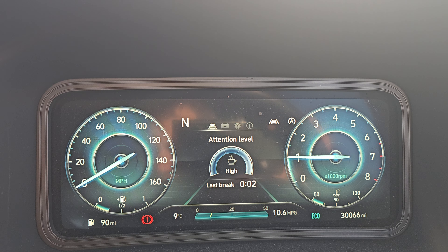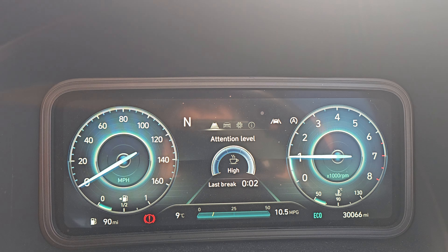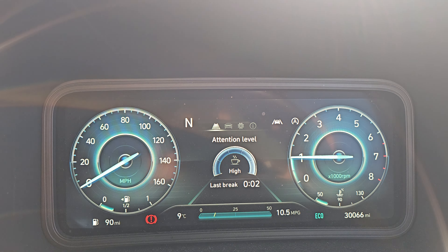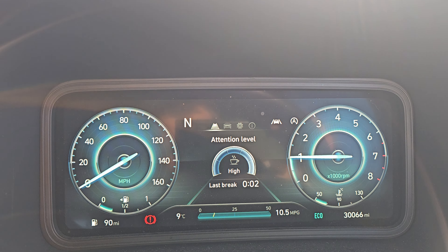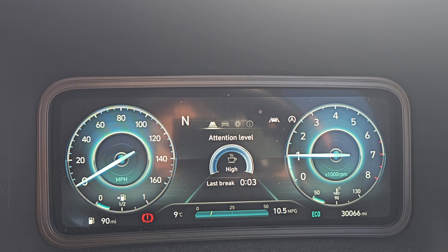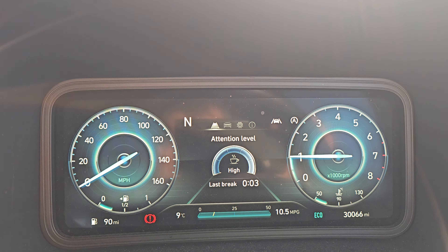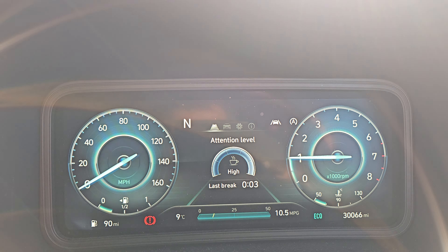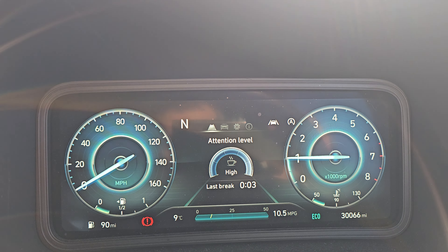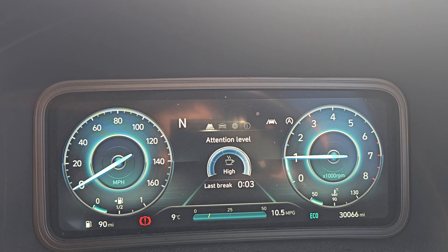So you have to obviously do an air fill check — if there is any air in the system. If there is not, you can then do a touch point adaptation and everything else, but you end up with the flashing light on the dash. So if that happens to you, don't worry. Make sure you have no fault codes, then just do normal air removal, and then just go for a road test even if it's still flashing. The car will drive just fine. Once you have a couple of ignition cycles on and off, the light will go off and it will go back to normal. It's just a bit weird, that one.